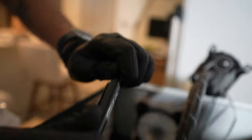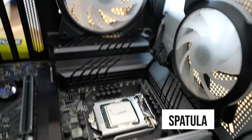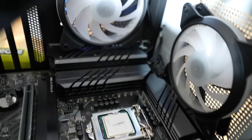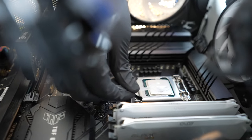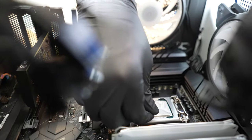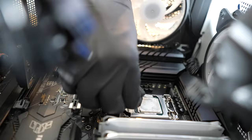What you're going to do is put a little dot right in the middle. What you can do for a better spread is use a little spatula to cleanly apply it evenly throughout your CPU. That evens out the whole thermal paste so you can have the best cooling and most surface area possible. As you can see, he's putting on the thermal paste — you don't want too much, just enough. Drop the thermal paste on and evenly spread it out, because the more even the thermal paste, the better the cooling of your CPU.